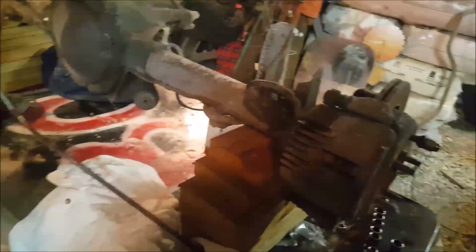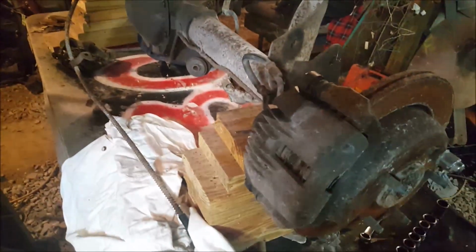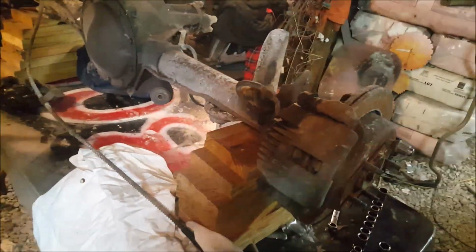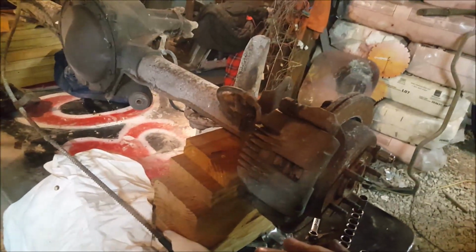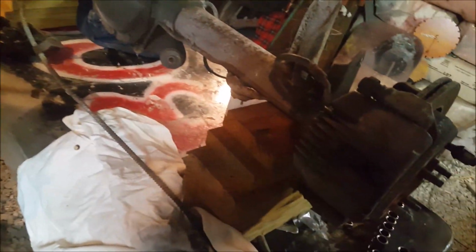These are the same thing that's on the Corvette and the Camaro too, but I'm just saying, if I wanted to spend money and get a big brake kit for the rear, it could be a twin piston, you know, rear brakes. I ain't worried about it. Most of the braking's done in the front. It's way upgraded now. So these are just going to be basically cleaned, painted, put back together with the upgraded brake rotors. But all this stuff's breaking free real easy, coming off like nothing, which I am very glad, because breaking a bolt off in one of these brackets would be a nightmare to drill out and replace.